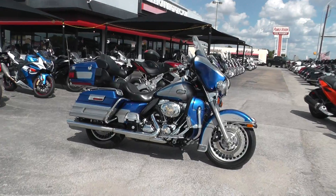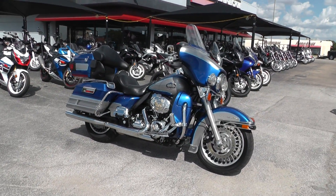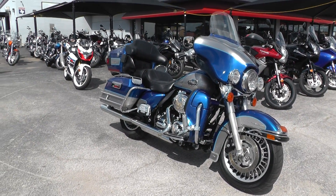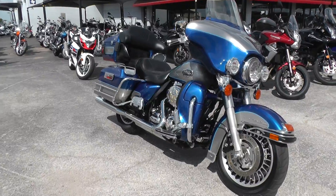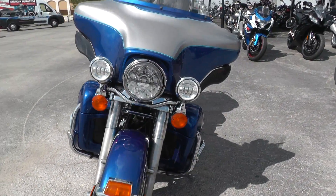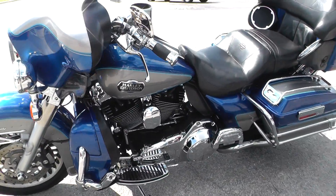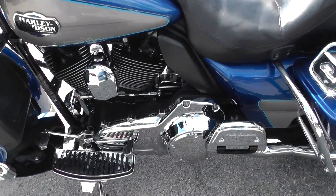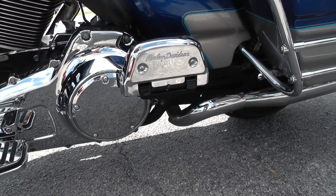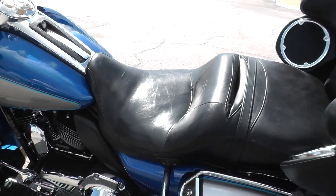2009 was the first year of the widened frame and several other engineering changes made by Harley-Davidson. They ran the exhaust underneath the bike, which keeps the passenger's foot cool on this side, instead of it coming out on top of the primary right by the passenger floorboard — it comes underneath. So that was a handy little change, as was the widened frame.